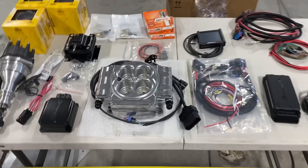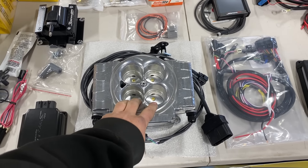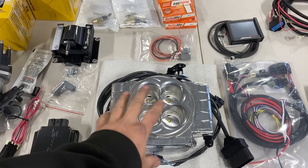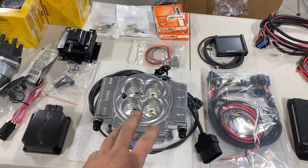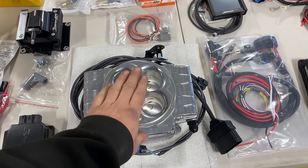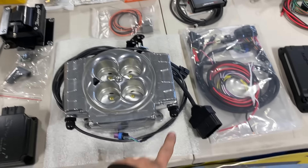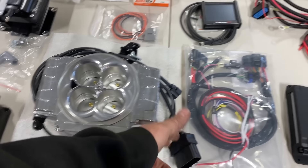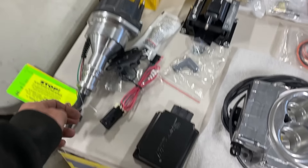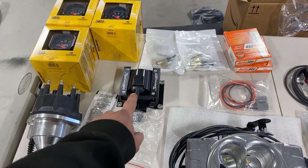Let's show you what we got. We have the new Holley Sniper EFI. The old system had injectors on top with a separate ECM. The new system — if you have a carbureted car and want to go EFI, this is the only thing you need. It bolts right up. All of the injectors are inside here. You just need to give it fuel and a return. This little connector goes to your spark box and you need a distributor with an output. We also got the HyperSpark coil for it.